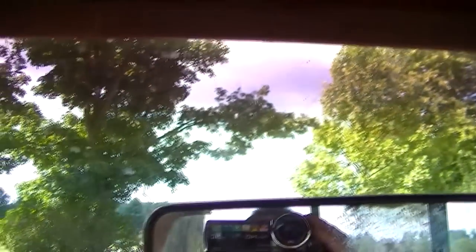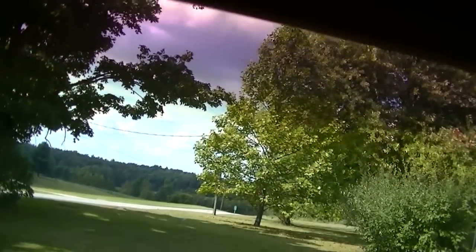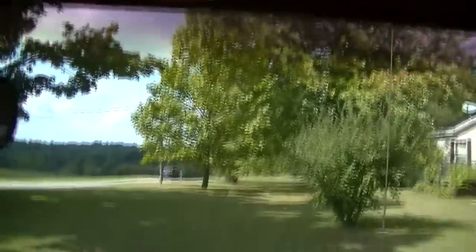I have it almost stripped down all the way and I'm getting this piece of trim out. The way I'm doing that is fishing up in here — there's a little metal clip, you can see what it looks like. I'm just getting in here and pushing in on it just a little bit and popping it out. There should be another one right about here — right there is where it's at — just going to push in a little bit and pop it out. And there is one more clip left.